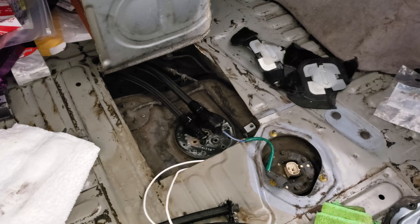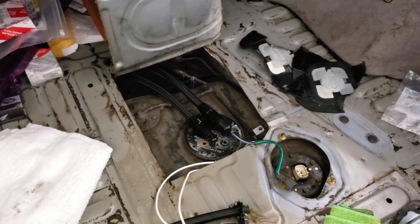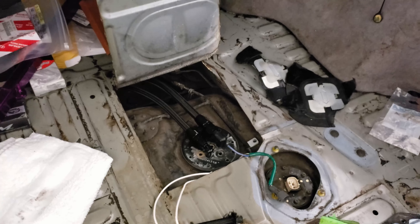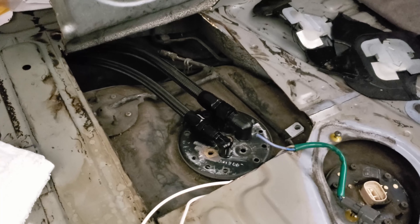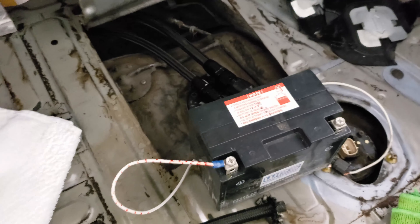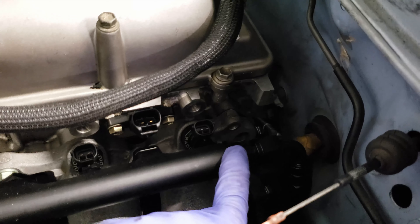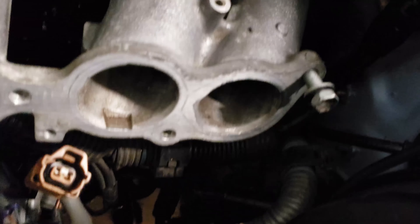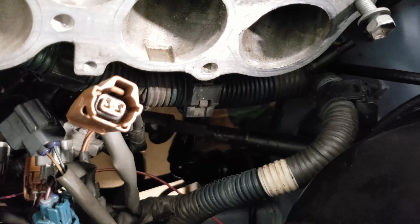Got all the lines hooked up. Next thing I'm going to do is prime the system and check for any leaks — I imagine it's probably made the fuel rail. I'll check for leaks and then instead of putting the engine harness in, I've got to wire some things inside the car under the glove box first. Fuel system check done. Had two small leaks — one at the feed on the back of the fuel rail that always leaks on me when I first start up, and the backside of the fuel filter was leaking just barely. Got both those tightened up. The return is all good.